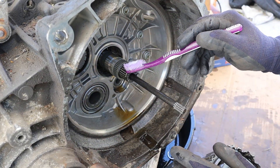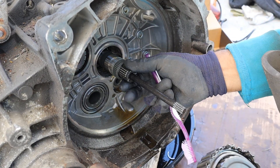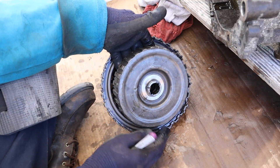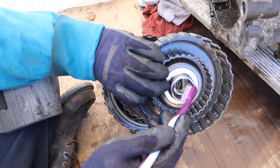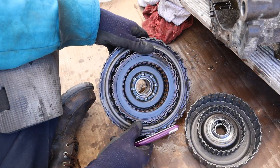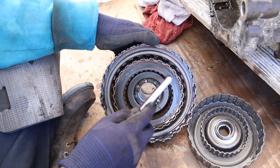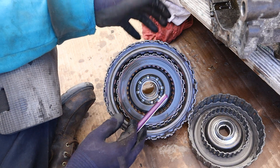You can see these two shafts here — there's one that runs on the inside and one that runs on the outside. There's a set of clutches that work on the inside shaft and a set that work on the outside shaft. Taking this apart, we've got two splines: the larger one splines to the outside part of that shaft on the transmission, and the smaller one splines to the smaller shaft. Inside we've got two wet clutches, one on the outside and one on the inside, and they're encased in fluid for both cooling and longevity.